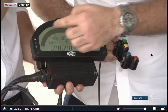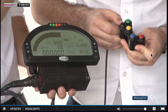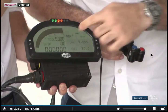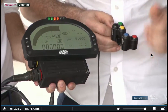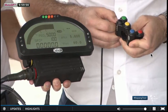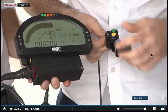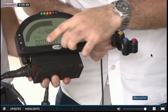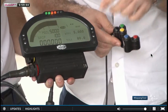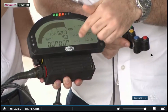You can see the typical information here is the RPM — the engine speed — so the riders can understand the RPM, when to change gears and so on. This is called a dot matrix, and some special information can be displayed here by rider request, so they can put pressures, temperatures, grip, whatever. These sections are typically lap time and some other important information, and also if there is an alarm on the bike or a flag from the marshals, it is displayed here.